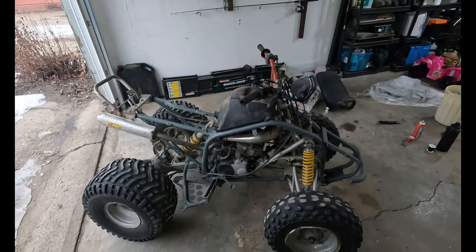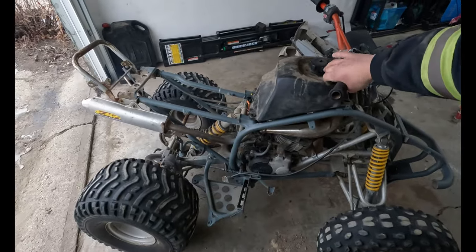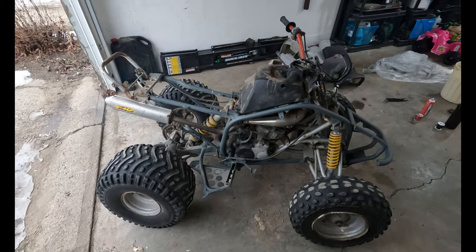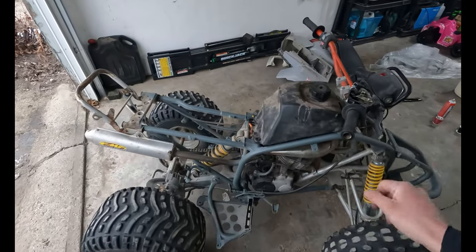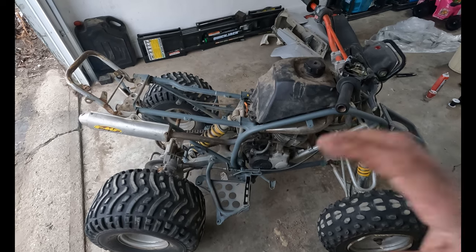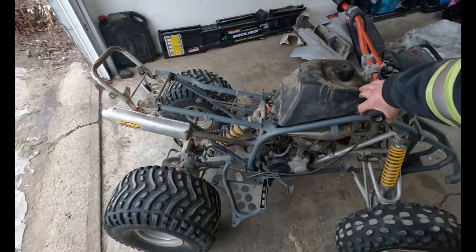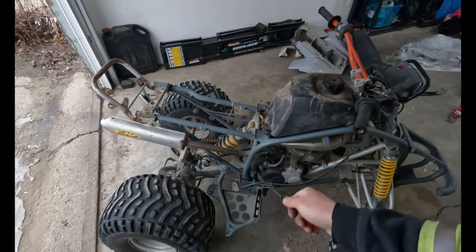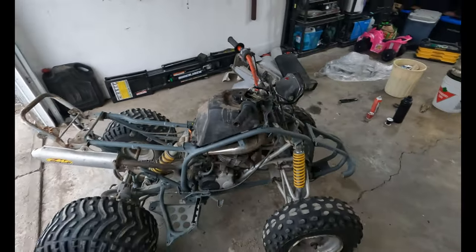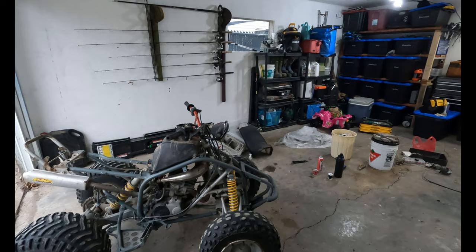that's the product. Flip it. It's getting close, but that is with the air screw all the way in. If I let that air screw out at all, it starts to idle higher, and then rev hang a little bit.